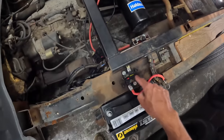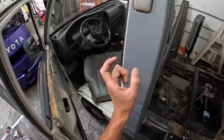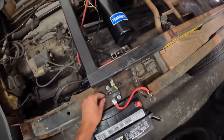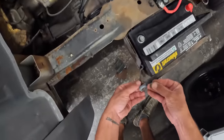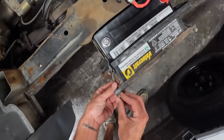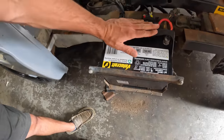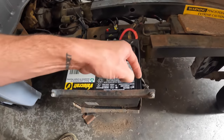Okay, the handle's gonna be a problem — we'll get it off later. Only because Sergio put this breaker right here, and basically what this allows me to do is completely cut off all the accessory power running to the switch panel. That switch panel has a tiny phantom draw — clearly I've left it on for a couple of weeks and run the battery down just a hair. So if the thing's gonna be parked for a while, we've got this breaker here and we can just reset it to kill all power. Let's get this booger attached.